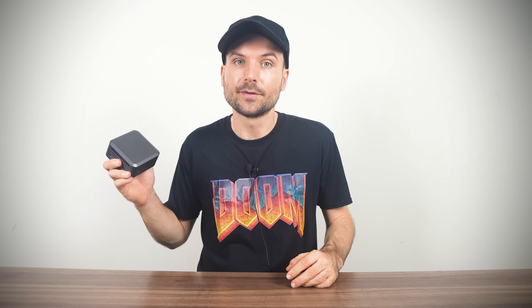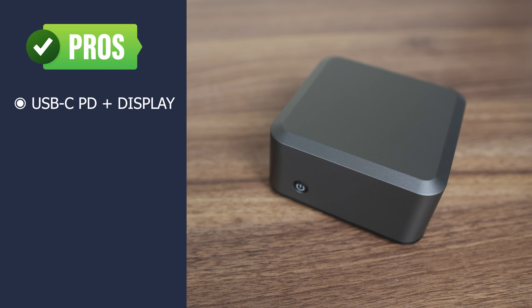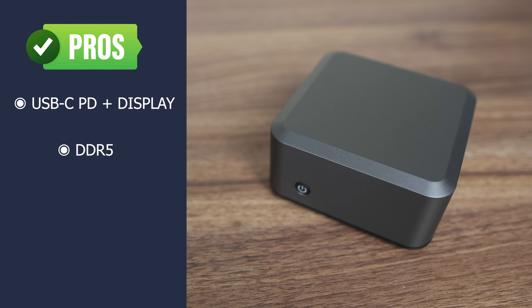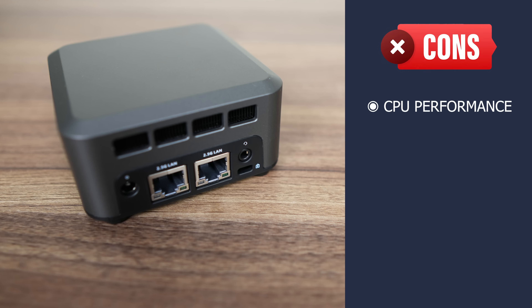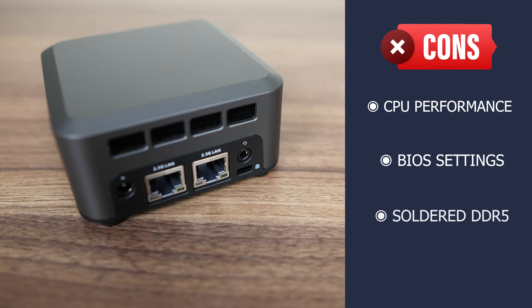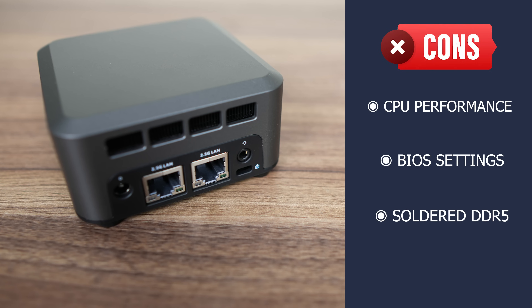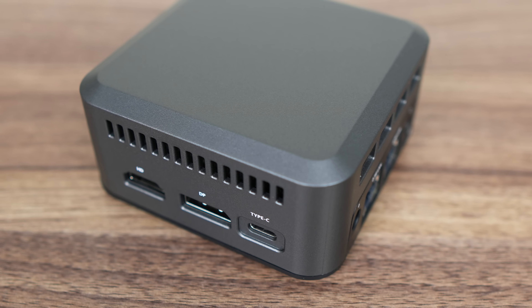The AUSTAR N1 Pro is one of the only tiny minis to include USB-C power delivery and display, and that gets a big thumbs up. DDR5 is included for the price. Cooling is good with a low maximum CPU temp, but CPU performance is lower than other minis, and changing the power mode doesn't bring it up to where it should be. The default BIOS settings should be properly configured out of the box, and non-user replaceable memory is always a downer — the Ace Magic Vista showed a SODIMM slot can be done on a mini PC this size. Pretty decent for the price, with some flaws, some of which can be fixed by the user.